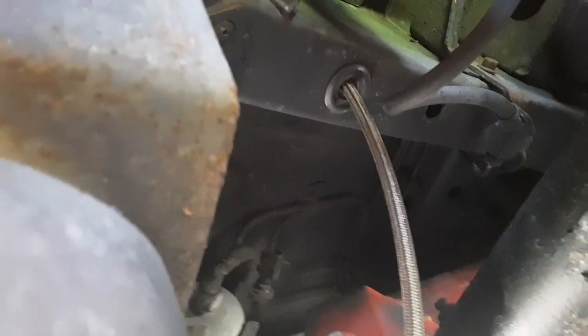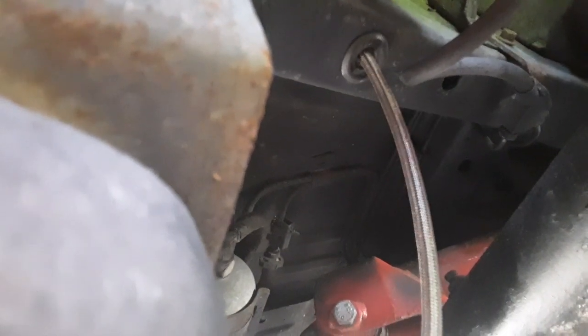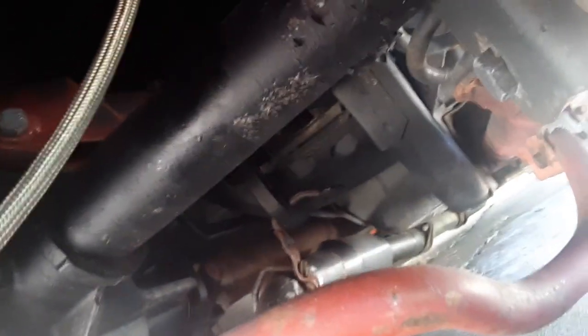All right. Underneath the car, you see it comes through the frame rail. I added that grommet because I didn't want it rubbing. Just make sure when you pull all this out, you don't just pull the grommet and it goes with it. Now I'm going to find a path to run this, probably up with the brake lines and down this side right here. I can just zip tie it to the existing lines, and we'll go all the way to the front. I haven't cut the zip ties yet, but basically you can tell I've just ran it along these lines